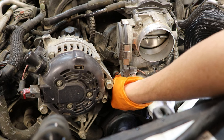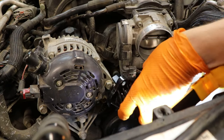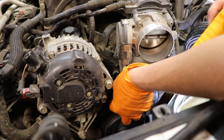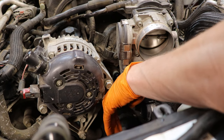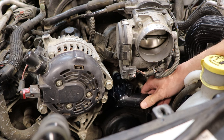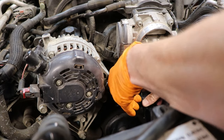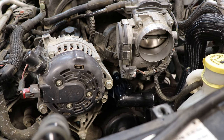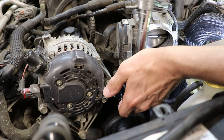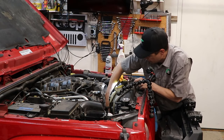Now I want a nice clean surface for that new rubber gasket to sit on, so we're going to wipe it off real good with some brake cleaner. Let's drop our new thermostat in place and get this lined up just like so. Get some bolts in there. I can torque these two bolts to 108 inch-pounds — not too super tight.